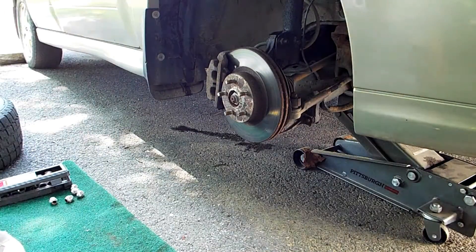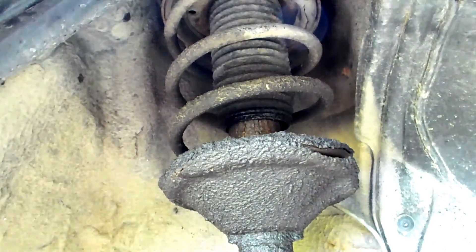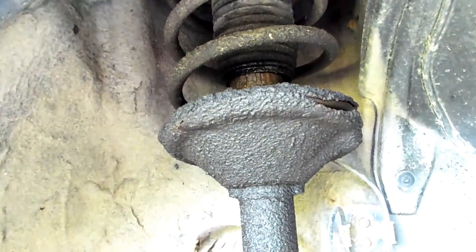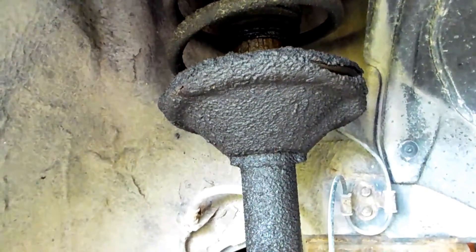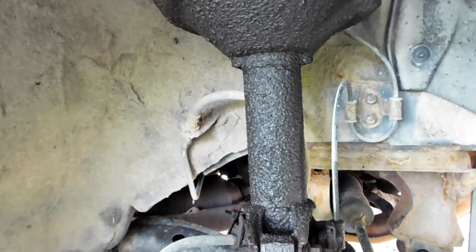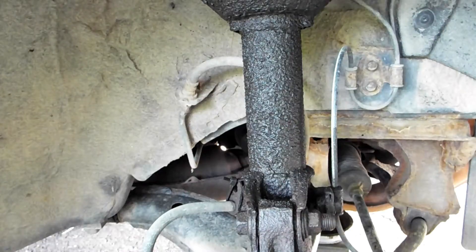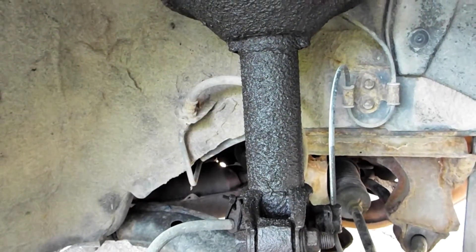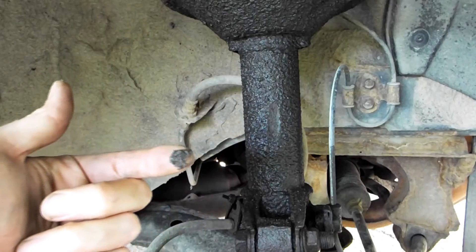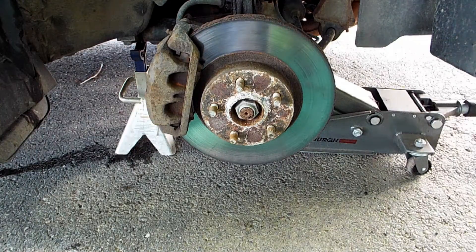Here's your problem moment - this thing is just covered with the oil that was once on the inside of the strut. If your strut looks like this, it's beyond replacing - you should have already had it replaced. I should have too. This thing is a royal mess. Might have to dig out the rubber gloves for this removal.